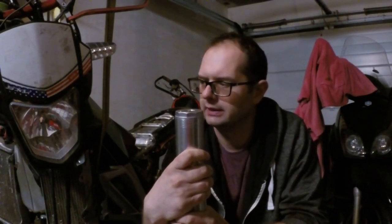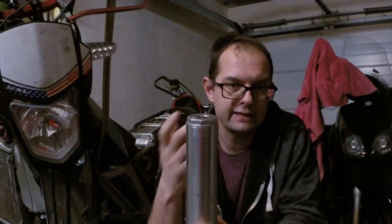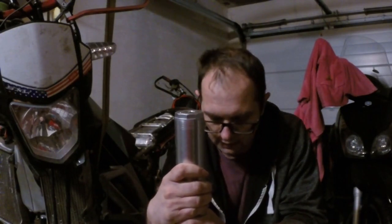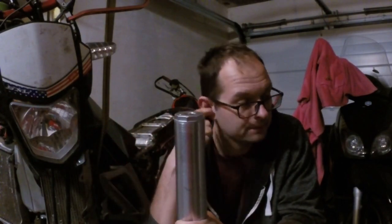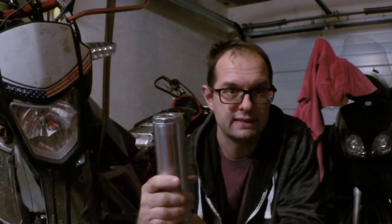So then you will have to turn out the compression. If you feel that it is still pretty comfortable but still too soft, just go two, maybe three clicks turn in and see, and make a test ride again and check if it's still comfortable enough and if you have good handling. There you will reach a limit where the suspension is stiff enough, but there is enough comfort to drive normally. For example, there will be a different setting for a nice flat track and a different setting for road riding, like to work or something.